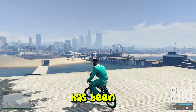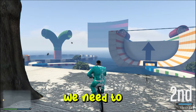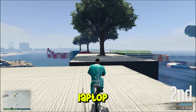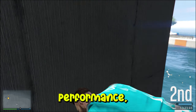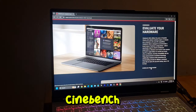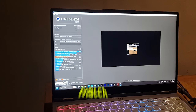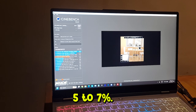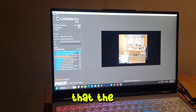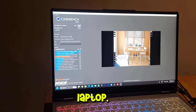After all the drivers and Windows have been updated, the laptop is ready to be used. But we need to check if after all updates the laptop performs as well as expected. To test the CPU's performance, download and run the Cinebench R23 benchmark for a stress test and see if the results match the standards. A variation of about 5-7% is completely fine. Make sure the laptop is plugged in while testing and no other work is being done.